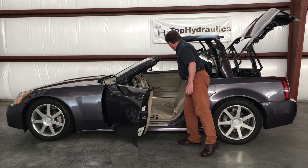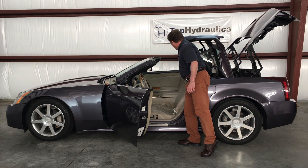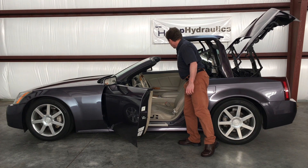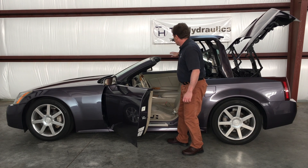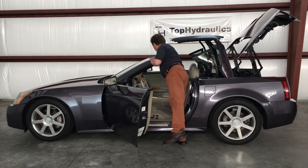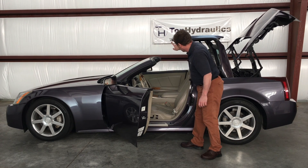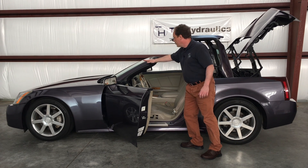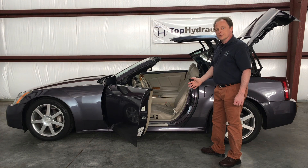There are the top locked and unlocked switches in the front lock here, that simply tell the computer whether this latch has been latched all the way or unlatched all the way. And lastly, there is the top closed switch, which is in the far right corner of the windshield header and gets triggered by one of these pins when the top is inside the windshield header. So those are the five micro switches.